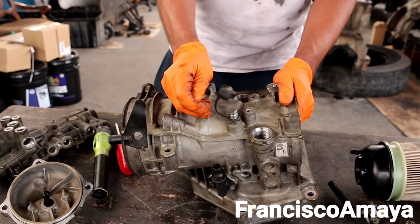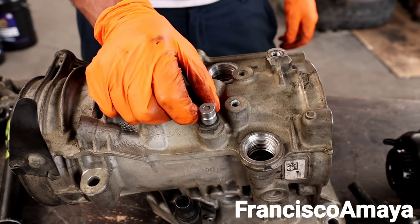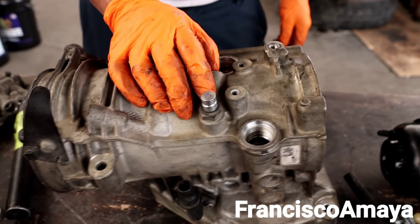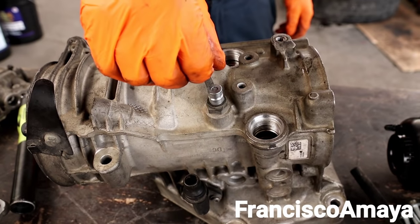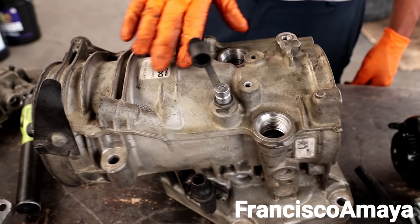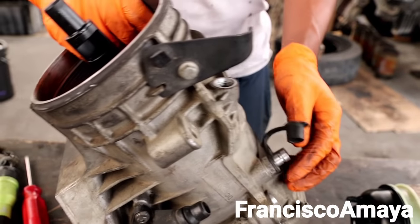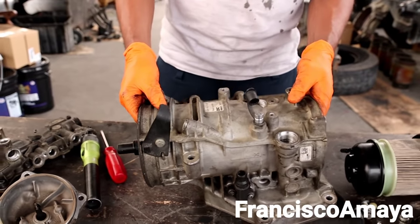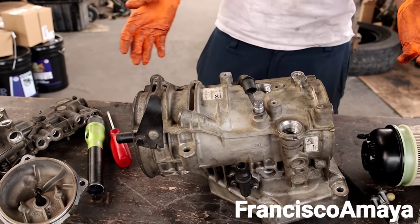This over here — if you wonder what this is — this is to use the tool to measure the pressure of the fuel system or to refill it. You connect the adapter here and then you fill it or measure the pressure of the low side pressure system. This whole thing is connected to the housing over here because this is where the low pressure side will be.